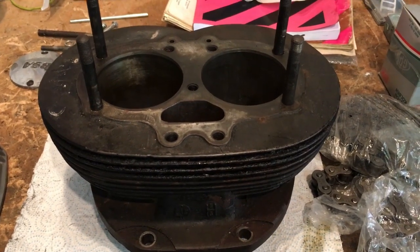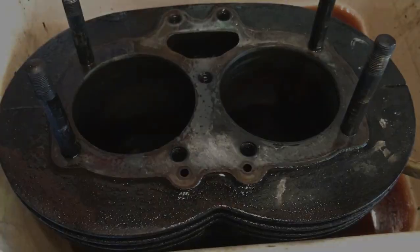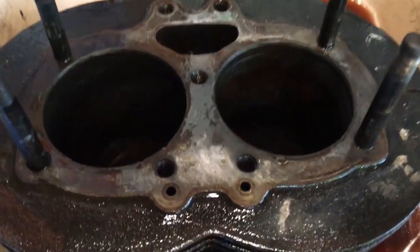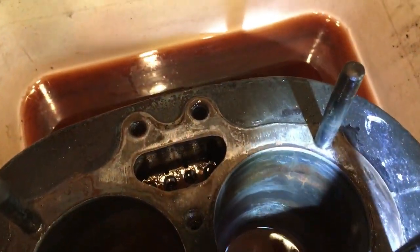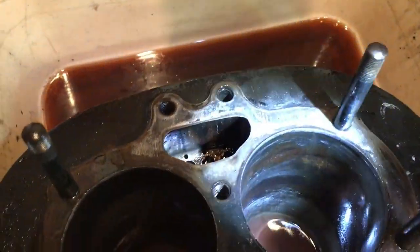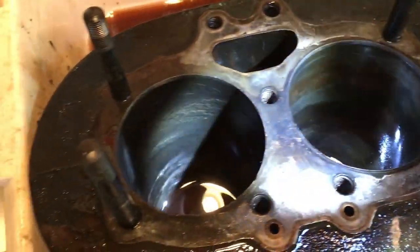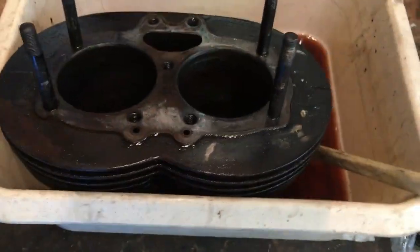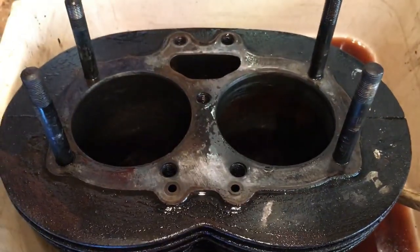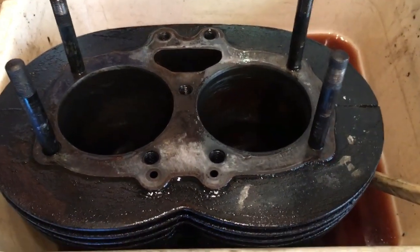First I'm going to fit the chain on the rear of the bike - I'll need to take the chain guard off but that's just one bolt at the front. Then we're going to get onto these barrels. Bath time - giving this a good wash down and soaking in Gunk, doing a bit of initial cleaning on the bores. I can still see honing marks on these bores, which hopefully bodes well. I'll give it a good wash down, plenty of soaking and scrubbing with a soft brush, and then a very light honing. Still can't feel any ridge at all towards the base of the barrel, so that's good.